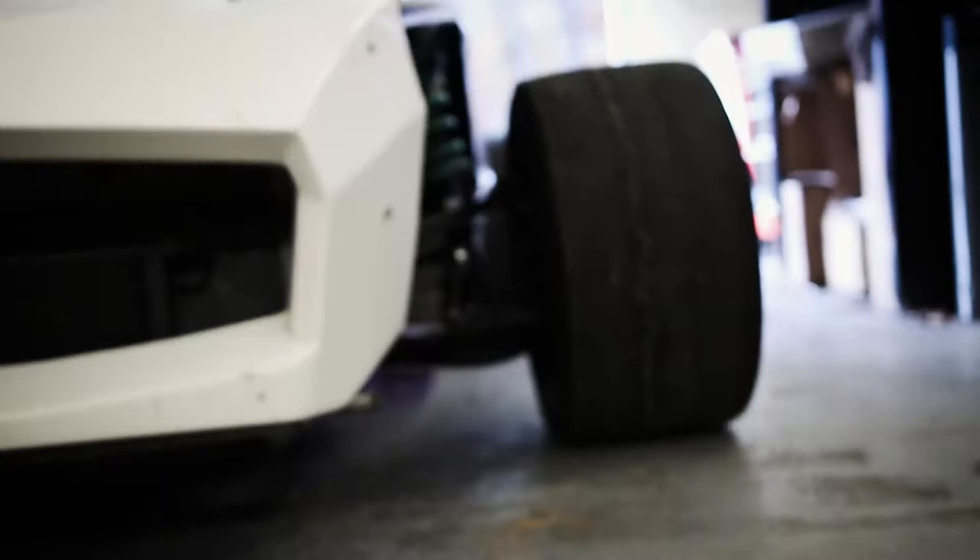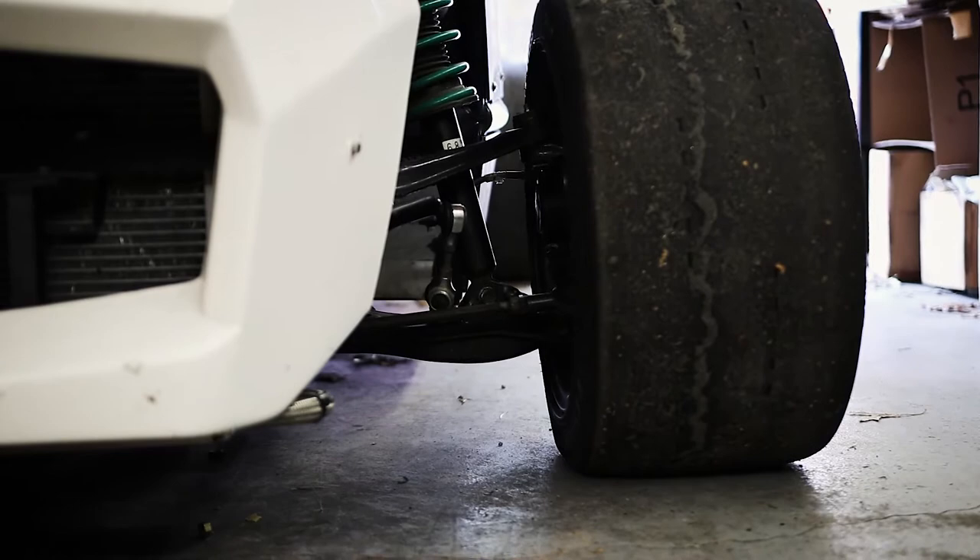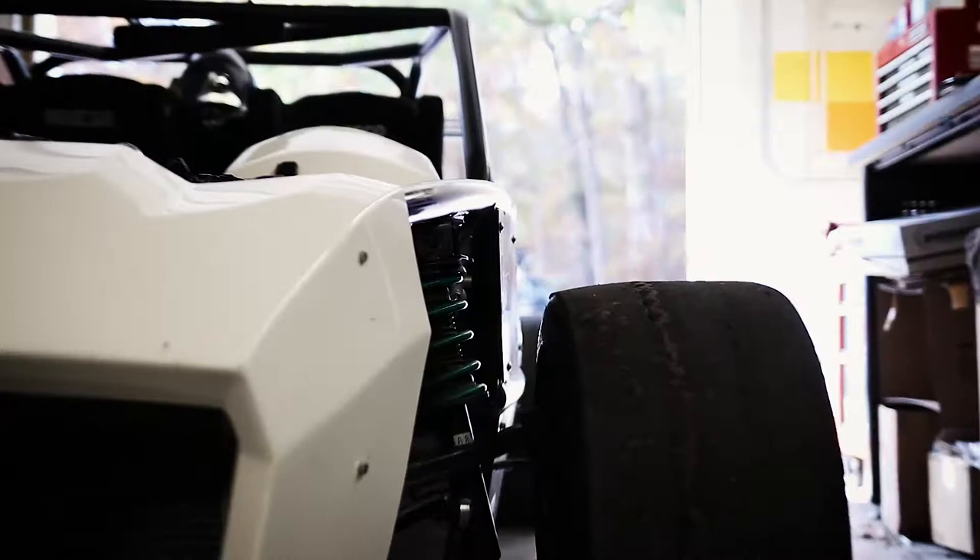I really like Dino's setup, I love it — it's black, it's menacing, it's called Death Machine. Just by looking at Dino's setup it's obvious that his tie rod ends and his control arms are a lot more parallel to the ground, which is how they should be because of the spacers right up there. So that's what we need to put on my car.